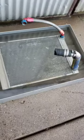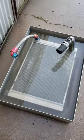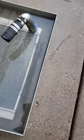It's really important to clean your radiators. I've got this aluminum tank and I've submerged the radiator in it with the radiator cap on, hoses on, and I've filled the inside of the radiator up with water. We're just going to let it sit there for 24 hours, and you can already see how the crap is starting to flow out of it.